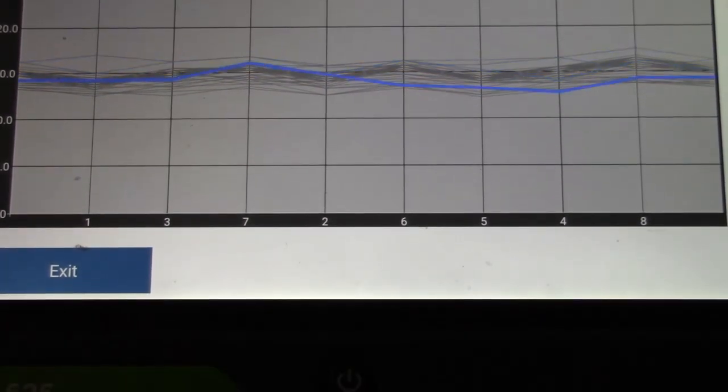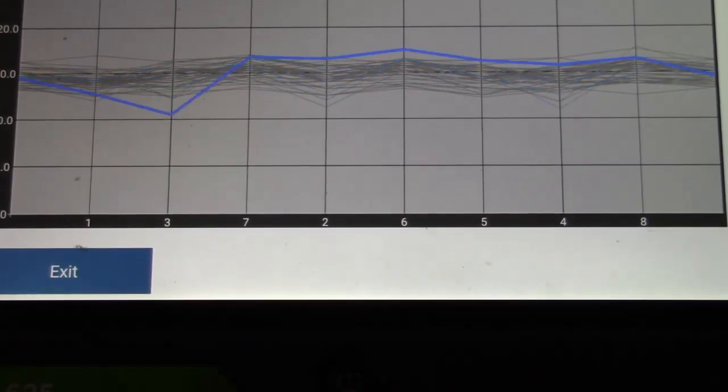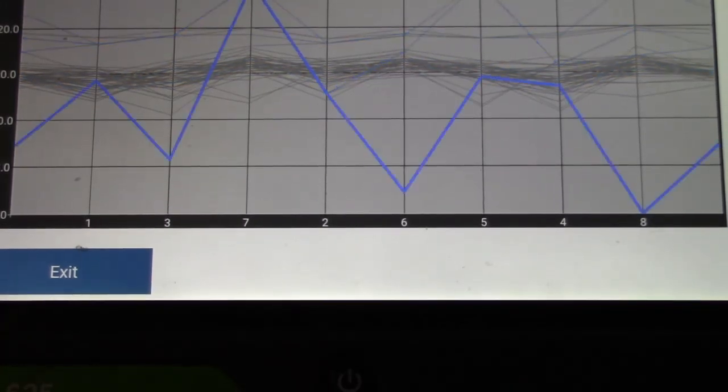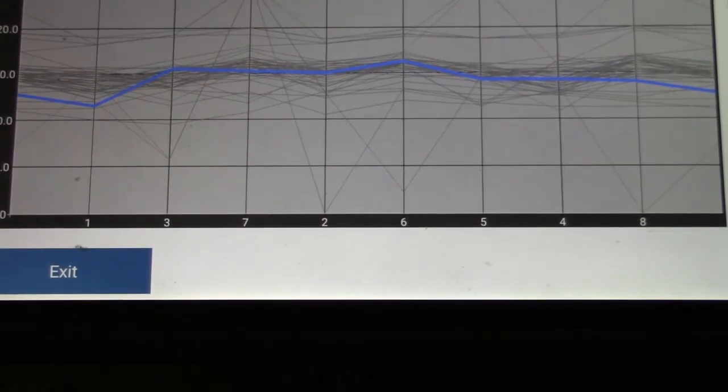So just keep that in mind if you're doing testing like this, that when you change RPM on here, it sees changes. It's going to change cylinder speed on the crankshaft. It's going to show up as misfires. So you want a steady RPM, and under a load, so you can stress the coils, is always a better option than just sitting at idle. Okay. Just little things that you pick up along the way, you know what I mean, little tips and tricks. So hopefully it helps somebody if you're using a power balance test and are not familiar.